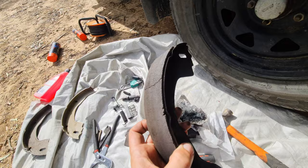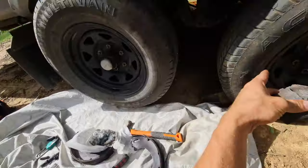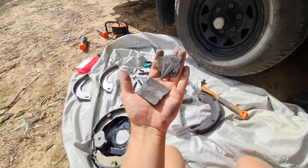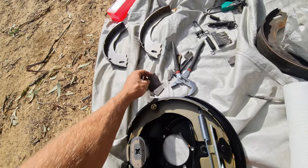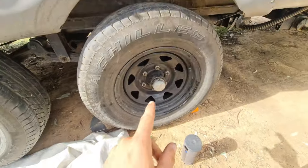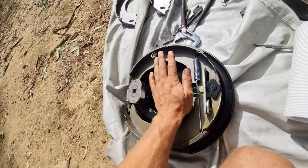This is why I'm changing mine — they're all cracked to the max, and this one has actually completely cracked off. It's because Tasmania has super steep areas and sometimes I had to crank the brakes up heaps. It seems like there was a problem where this side of the caravan was like a hundred percent brake and the other side was like zero. So this side got incredibly hot, particularly this one here. It has some problems, so I'm going to replace that whole piece here.